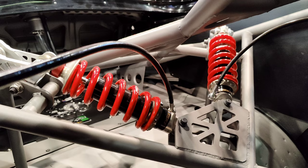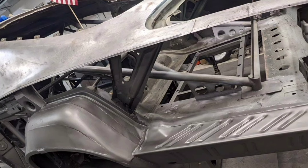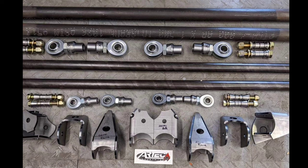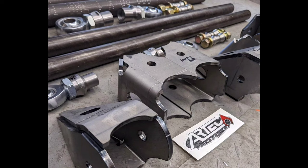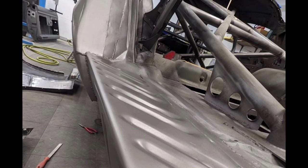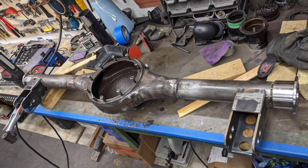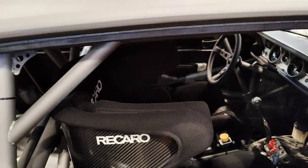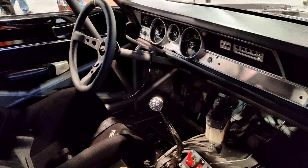I can completely set it up. The rear suspension is just the most beautiful thing we've done here. It's a triangulated four-link setup under the car, so it doesn't have any leaf springs or anything. I built the four-link completely custom — I took measurements and calculated the anti-dive, anti-squat, and moment of inertia for the entire car, so I got the setup that works with the right ride height. I designed the rockers — this is version one, and I'll probably do a couple more versions. They're adjustable so I can change the ratio a little bit.